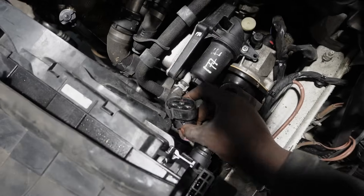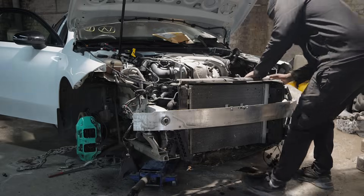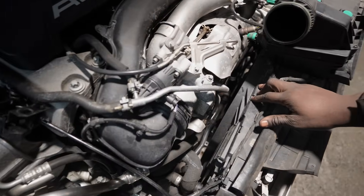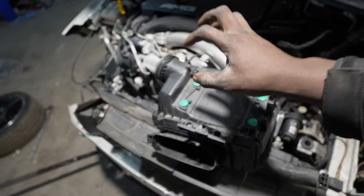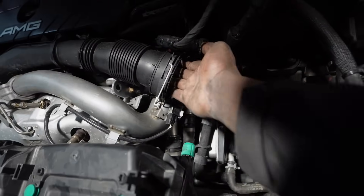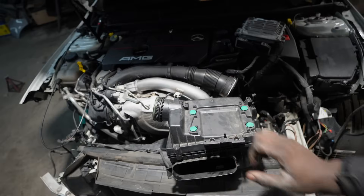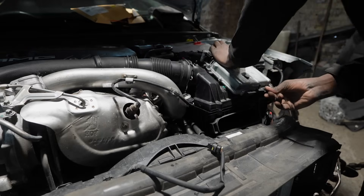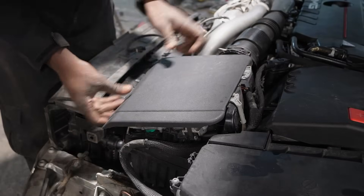What I want to do quickly before I go is plug the fan back in, switch the car on, and confirm everything I just said. The car's running — I'll leave it to warm up and check the fan. Now that I've got space in this area, I want to put the air box back on. When the car's moving in and out of the garage, I don't want anything flying in and potentially damaging the engine. That metal bracket that broke the oil cooler is actually for the air box — I was able to pop that in, pop the ECU in, and everything is looking nice and clean.